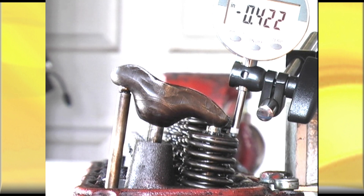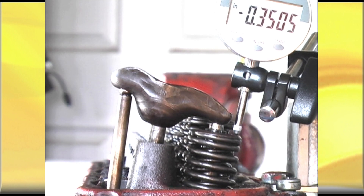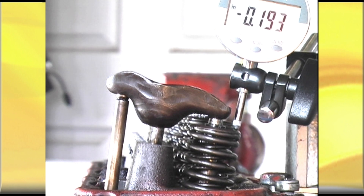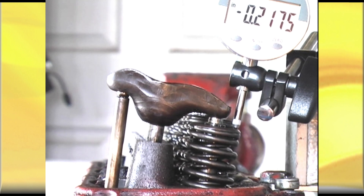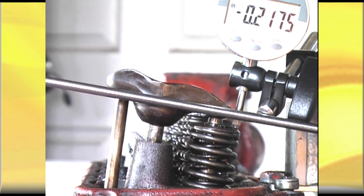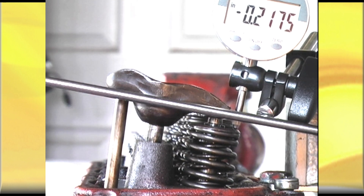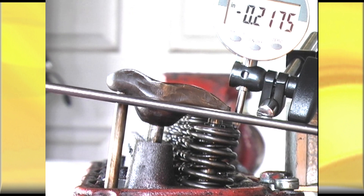Let's take this back to the center lift point. I'll take it back to half lift, so we're after around about the 200 mark. About 220 is somewhere around about the center. What we're after here is the center point — we basically want to form a right angle at the valve tip. As you can see, the pushrod is too long, and that's the way I've set it up. When I put the correct pushrod in, this angle will improve greatly.